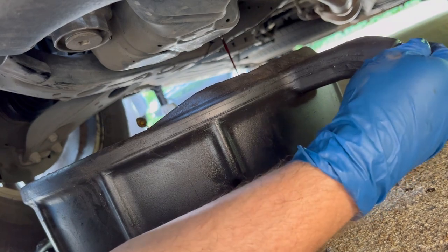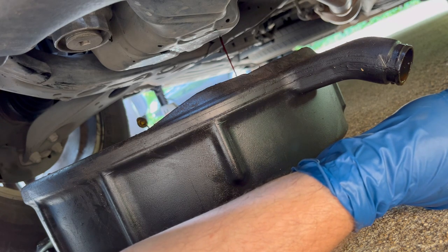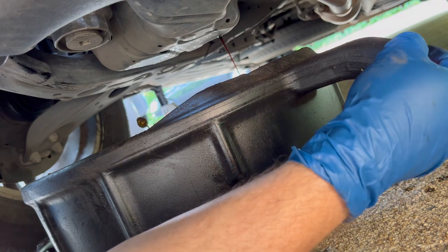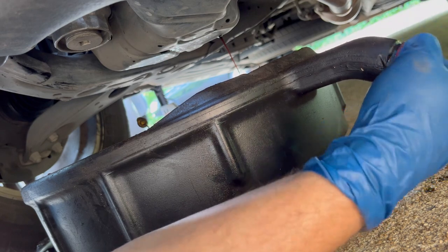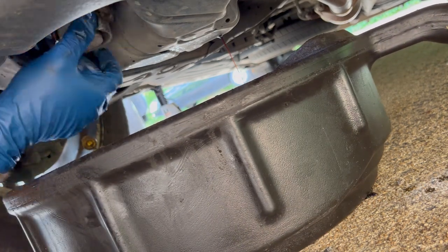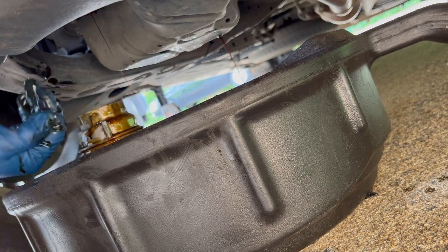The vent's not working on my oil pan — I just took the lid off the side and it's draining down correctly now. My vent must have gotten clogged up, I need to poke it out. That's why it was doing that bubbling. You can see now that the oil has almost stopped draining back at the plug. I usually let it drain until it gets to pretty much a trickle — I don't really have time to sit around and wait for every last drop. I had an uncle who would let his sit overnight because he didn't want to leave any in there — I thought that was a bit extreme.